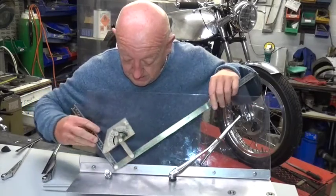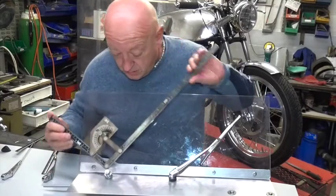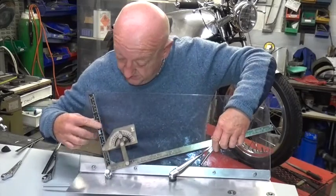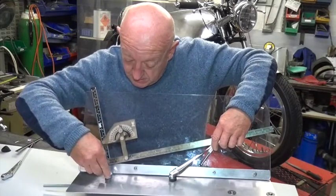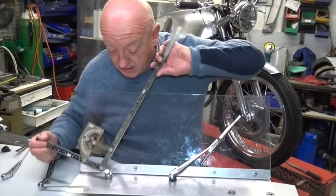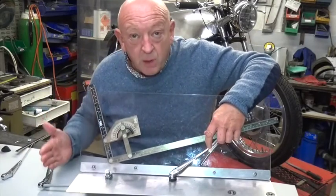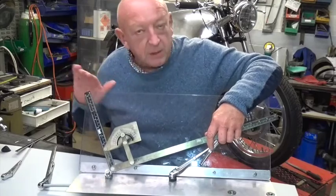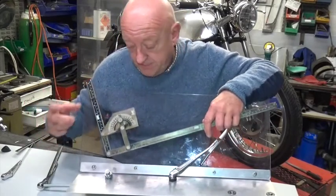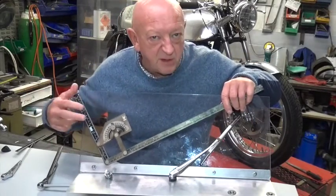You can set it to 90 degrees and mock up from your wheel box position the sweep angle. Remember the 90 degrees can be anywhere — you can mount the arm on the spindle in any position, so your 90 degrees can start there and finish there. Always bear in mind where the windscreen pillar is, and the top of the windscreen, and what length wiper blades you're going to use. You can choose between 90 and 140 degrees — we have several options.